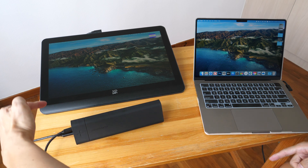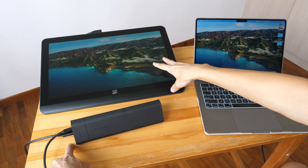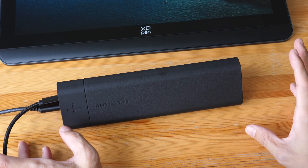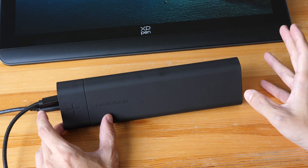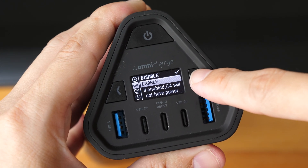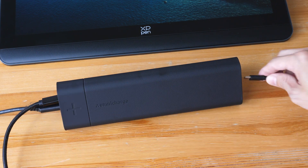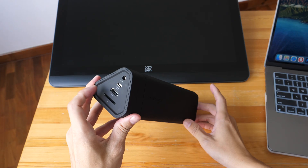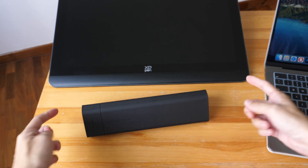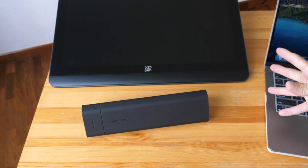Notice how the laptop is connected to this side with the HDMI, and the HDMI is working now. The downside here is this is just 4K 30Hz, not 4K 60Hz. It is possible to use all the ports with your laptop — in the settings you have to choose the 'Only HDMI' mode to disable power to USB-C4. You have to connect both sides to your laptop, but remember to disable power to USB-C4 from the HDMI side. Otherwise, when these two ports are connected to the laptop, they are going to oversupply power to your laptop, which obviously is not good.